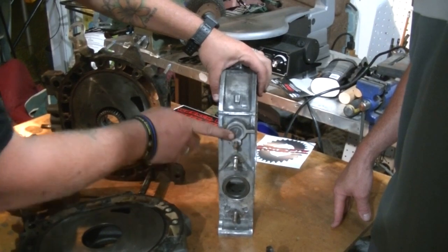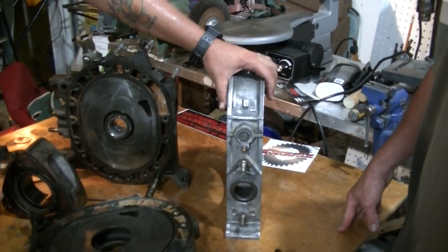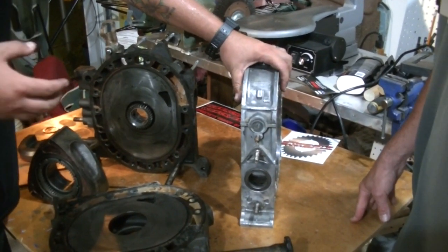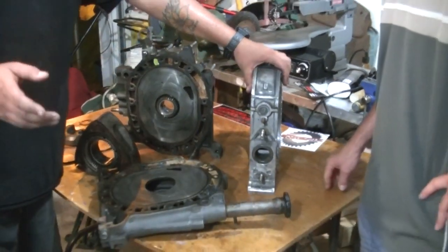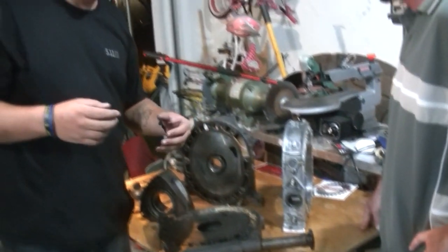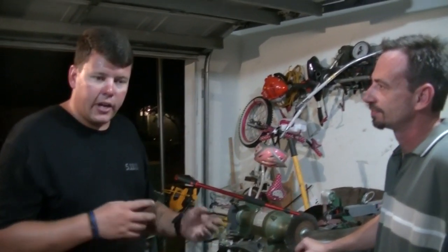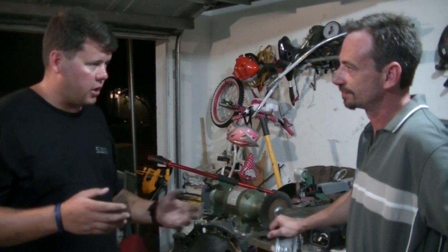So some of you have seen the 24-hour Le Mans, know the Mazda 787B that is a peripheral ported four rotor engine. It is made to run 10,000 RPMs all day long, every day, as long as it maintains lubrication. So getting into the peripheral port and the bridge port. These are non-streetable ports. The characteristics of the car, it enjoys high RPMs. It's not good for everyday stop-and-go driving.